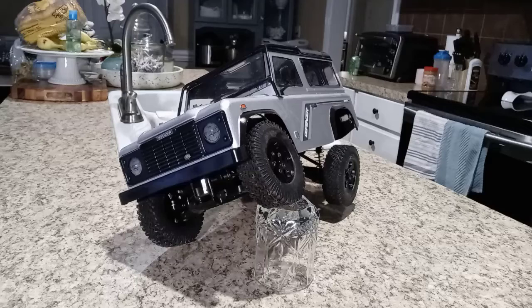Sitting flat, it does sit a little nose forward and a little higher in the rear end, so I know I'm going to have to address that. On the front, just to make it a little more supple and soft, I'll change the shock weight oil. I think this thing is going to be about ready. I'm not looking to do any competitions — I'm just looking to make it a little more capable. I honestly believe this truck is capable of a lot more than just running the trails, and with the right suspension it'll take on some class one terrain, maybe a little bit of class two.